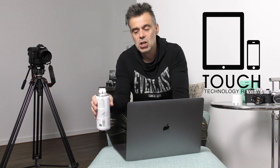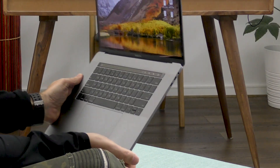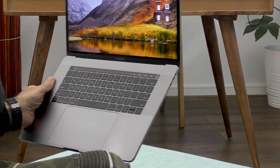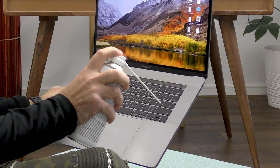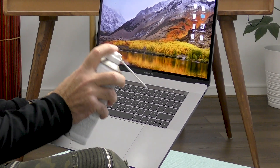You don't spray it in the position where the computer is sitting on your desktop — you actually need to pick it up and put it on an angle. Apple are quite specific about that angle; they ask you to put it on approximately a 70-degree angle. So hold your MacBook Pro up almost vertically and just tilt it back until you get to around the 70-degree point, then spray from left to right over the affected area or over the entire keyboard.